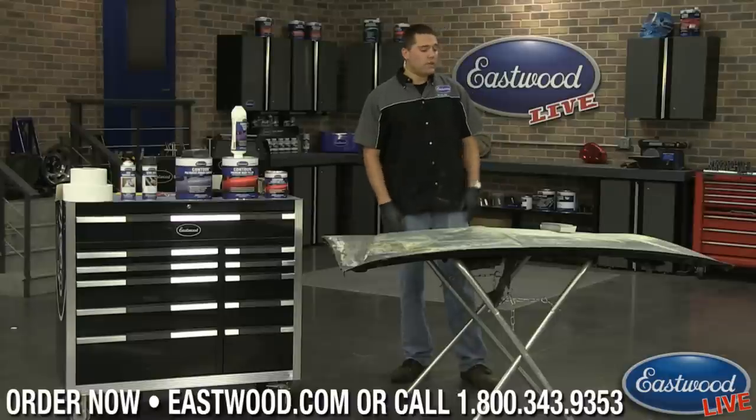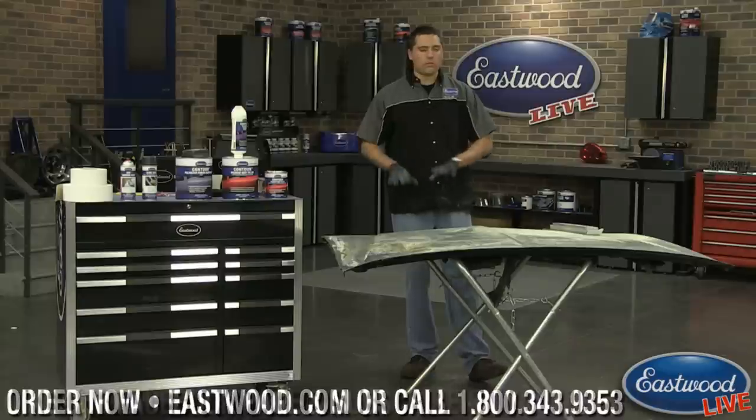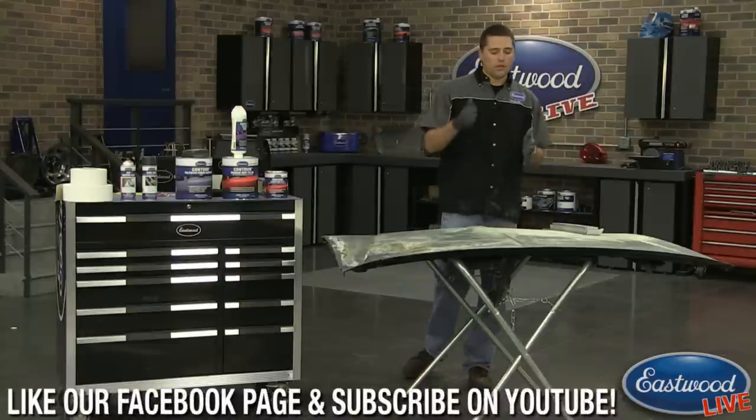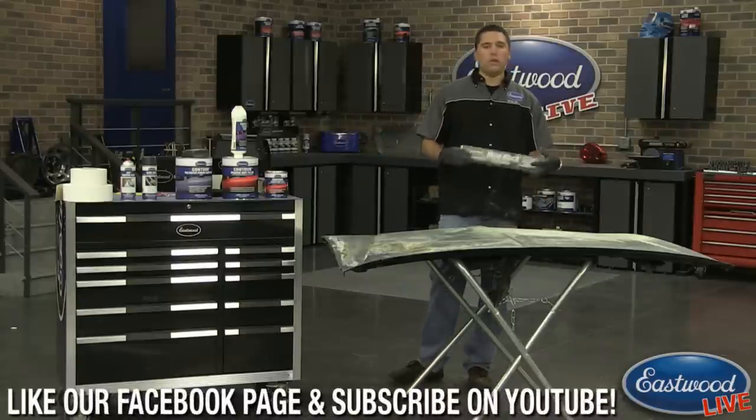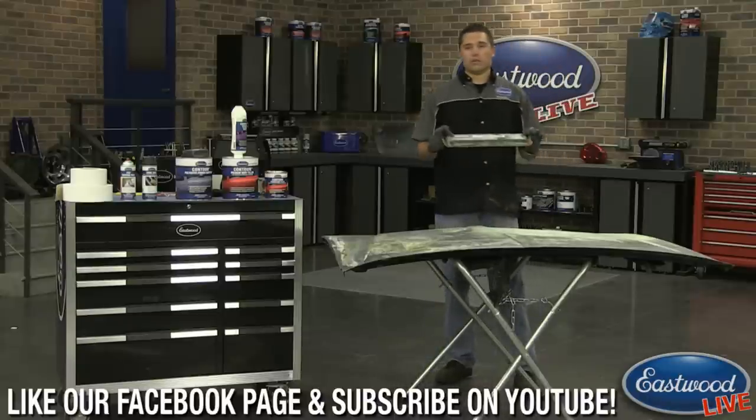That's the other thing. At times, you're going to need to come perfectly straight on an edge, but most of the time, as long as you keep it moving, keep it random where you're scratching, you're going to cut that nice straight panel. And also, the larger the repair, the larger the block should be as well.